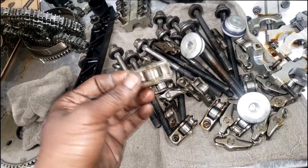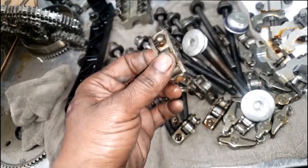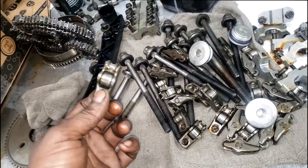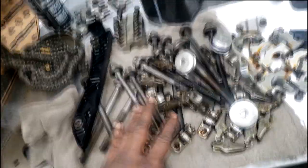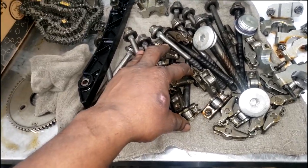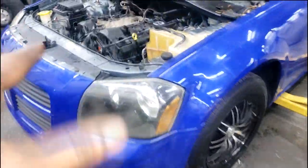The revised rocker arms in the Pentastar are of better quality — maybe they got back with the same vendors, I don't know, I'm speculating. But I've never replaced one of these for ticking on a 2.7 liter. This engine is timing chain operated, like the Pentastar — not a belt. The Pentastar is dual overhead cam. I can't remember if this 2.7 — yes, it's dual overhead cam as well. There are two cams on each cylinder head.